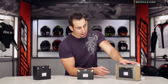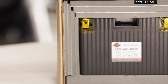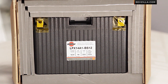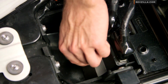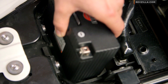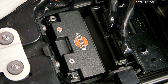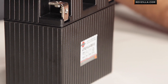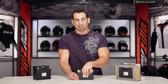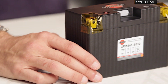This is the box it comes in. Because it is smaller and so much lighter, typically they'll try to get one of the dimensions – length, height, or width – the same as your stock battery. But it comes with all these dual-sided sticky foam shims that allow you to beef up the battery box so it's not going to slide around. Installing a battery on a motorcycle is absolutely a level one on a one, two, or three scale of degree of difficulty — if you can work a screwdriver and a pair of scissors, you're pretty good to go. The hardest thing in the process is really making sure that you put your bike information correctly at ShoraiPower.com and get the right recommendation for the battery to purchase at RevZilla.com.